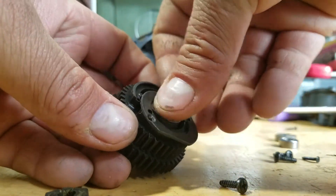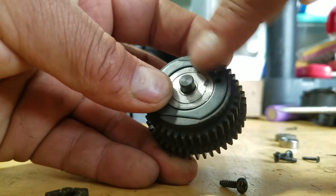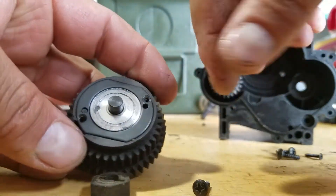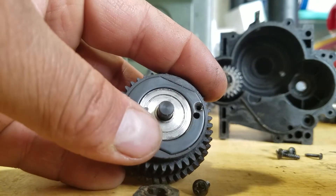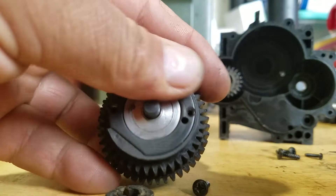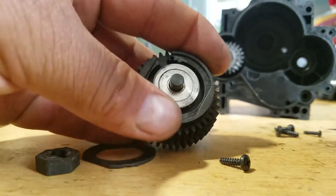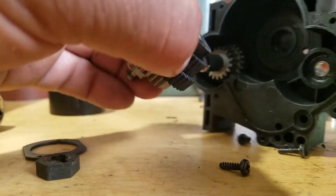Make sure you leave enough space to put this part back, because you want clearance - this sits right in the back of the case. If you put too much JB Weld it's gonna hit back here. But JB Weld is nice because you can always grind it, shave it around with a little sandpaper. You're gonna get it nice and flush. You can put a lot of JB Weld here and just shave it - get all the extra off nice and flat so it sits nice and flat. The better you do that job the better it's gonna fit back.